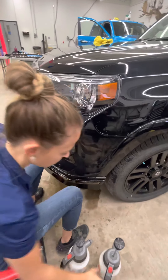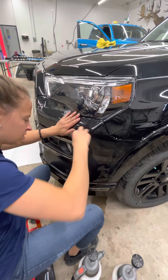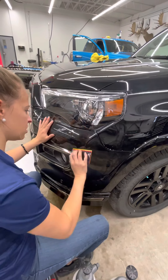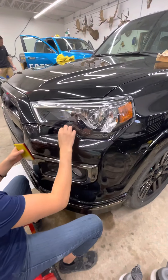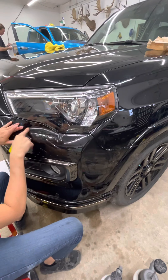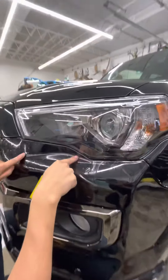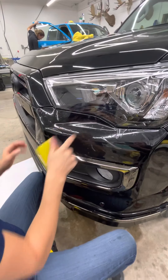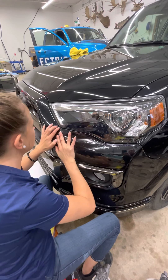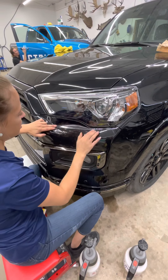That's okay. This one looks good — it doesn't look like a hard finger, so I should be able to just lay that down with some alcohol. If it was pointier, then I would have to stretch a little bit more to get it around that corner. Once you get into this spot, you want to kind of tuck this in, because if you leave it out and lock this top edge, you have nowhere for the water to go. So first get it kind of tucked in that spot so you can see if your line is actually lining up — because if it's off, you go to push it in and it actually makes it short. Our next tack point is over here. I'm going to spray a little bit right there and pull this up into that corner, lock that little corner in. I'm just going to use my finger to guide that piece in.